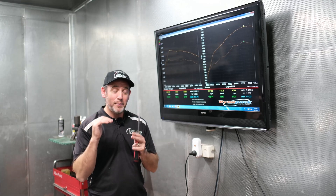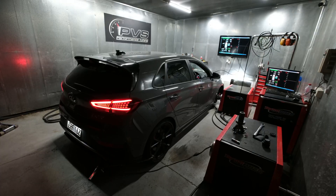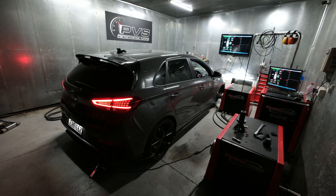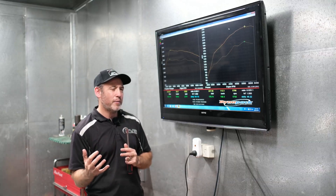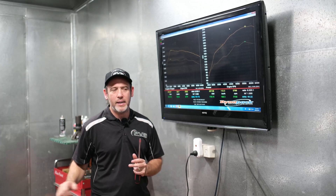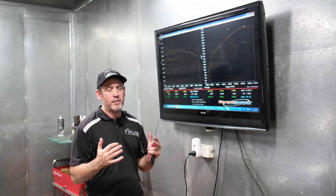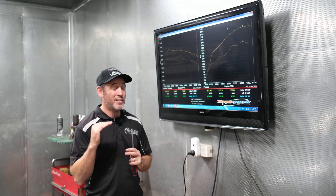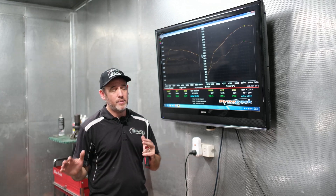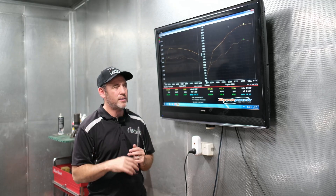So far it's been really good. We have found the limits of it, which is fantastic. Around the 22-pound mark is what we've done our custom tune package around. Anything more than that, we've found it's starting to slip. You may not feel it on the road, but we definitely feel it on the dyno, so I prefer just to keep them the way they are. We do have tune packages to run a bit more boost, especially if you've got a manual — it'll take it, it would go up to 24-pound. But DCT, we've found around 21-22 PSI seems to be its nice, safe limit.